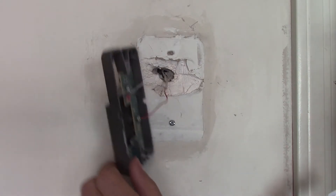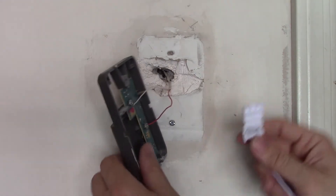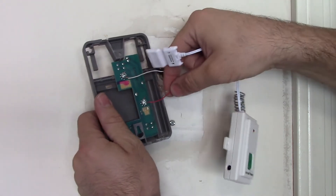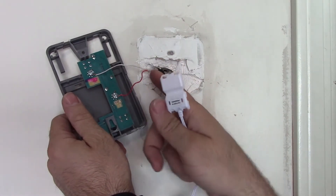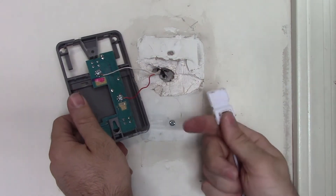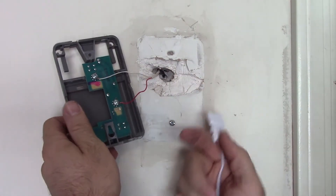I've stripped these back so you can see — there's two wires in the loom, and these are all twisted up. So you don't just want to clip it on there if they're all twisted. Open up the loom and get them to where they're easy to access.